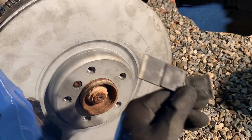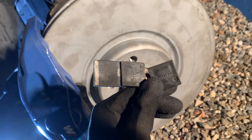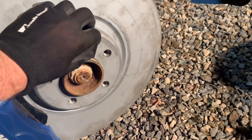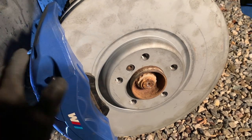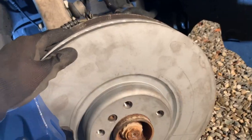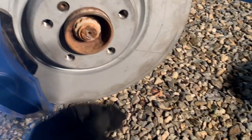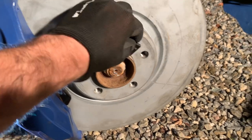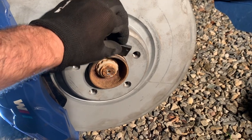I came up with this idea — I have two shims which are 5mm each. I'm going to do a test to see if a 5mm spacer will work. I'll place the shims on opposite sides and try to mount the wheel to see if that gives enough clearance. It's touching here and here, so a 5mm spacer should do the trick. A 3mm might work but could be close. Let me tape them to the hub and mount the wheel to show you how it looks.